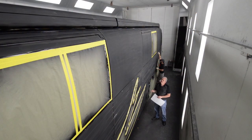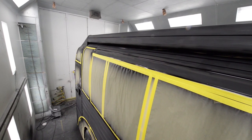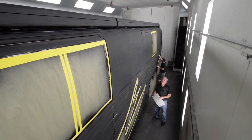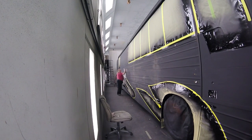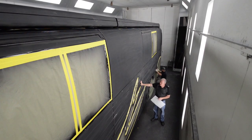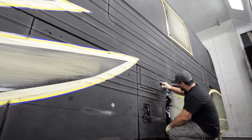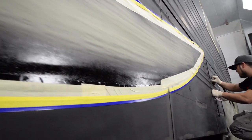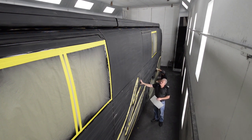This phase in the paint, they have already altered the front cap and the rear cap by putting on our own look, our own fiberglass. We've put on the brackets and the awnings up top — we especially do that early whenever we're going to put the design up through the actual awnings. The whole body has been body blocked. This is an X3, which has stainless steel ribbing on the side. A polishing crew has come through and polished it in the areas where it's not going to get painted, which is the masked area you see here.